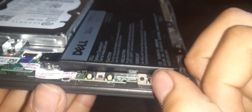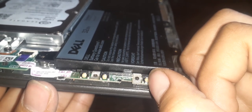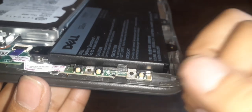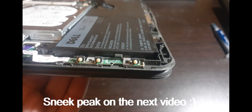When upgrading any laptop or desktop, always turn off the system and remove the power adapter so no power is on the system. What I like to do when working internally on any electronic machine is hold the power button for about 30 seconds to remove any electric discharge from the machine.